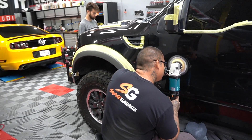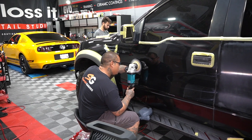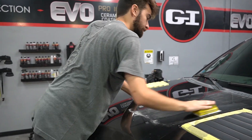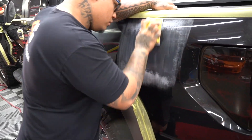After Alex and I talked, Josh decided that the side of the truck was going to need a high speed rotary process because our dual action polisher wasn't going to be aggressive enough to level out some of the imperfections. We had to sand the rear bed sides, the doors. As you can see, we've got focused lighting on the vehicle.